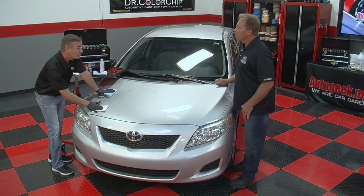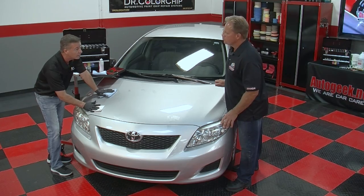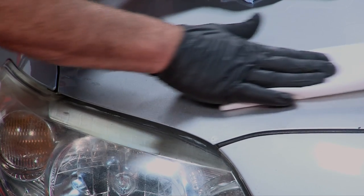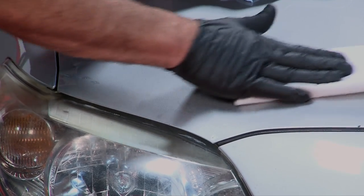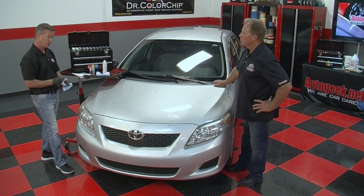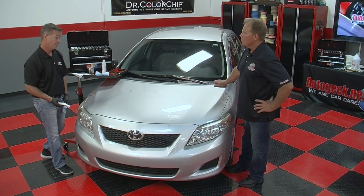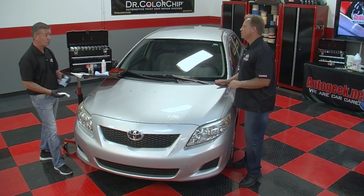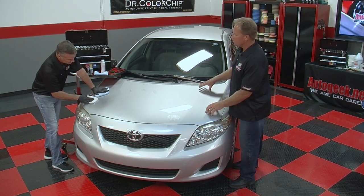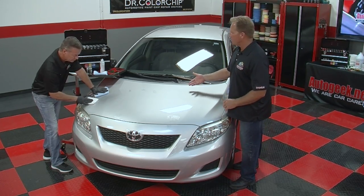Right. Your typical touch-up. And the older touch-up methods out there would leave paint blobs. It looked like your car had the measles. Everybody hates paint blobs. And there is a way to remove paint blobs. I carry a bottle of acetone around with me and Q-tips. If there's old paint blobs on the car, I dip the Q-tip in the acetone and I carefully go over the paint blobs, and it'll slowly dissolve that paint away. And then I wipe it wet with either the Sealac or water just to neutralize it. And the thing about modern base coat clear coats is the acetone is actually safe. It won't dissolve the paint that came from the factory. It's just going to take out the touch-up paint, correct?